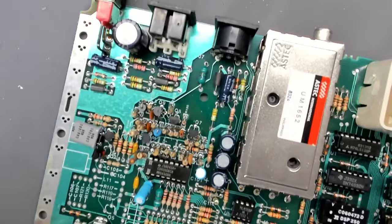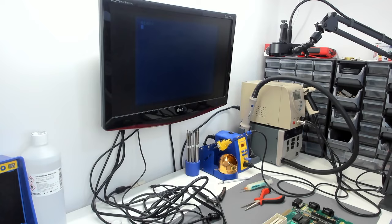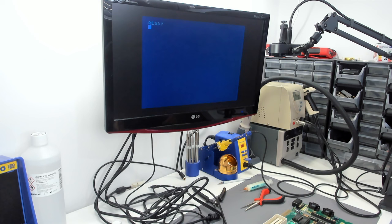There's the monitor jack on the board — let me show you that from the top side as well. So let's see if we get composite video at this point. Switching on — and we have a picture, brilliant! It's very difficult to see in this particular studio lighting, but you can see it a bit better now. It's murky because it's composite video, as you'd expect, but the color looks reasonably good. So we've got composite video coming out of the 600XL on the new monitor jack. Next we'll add the jumpers for S-video — luma and chroma.